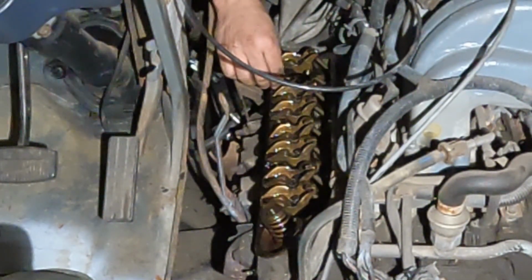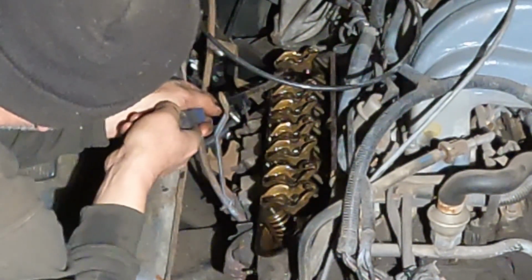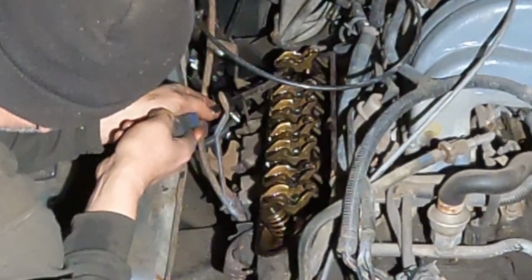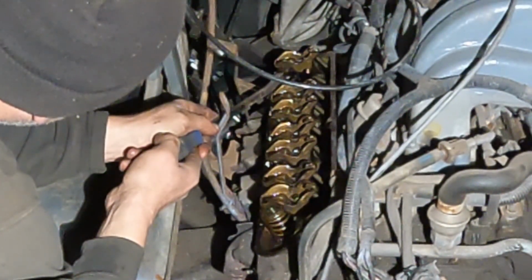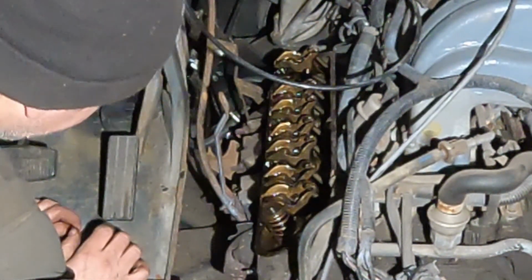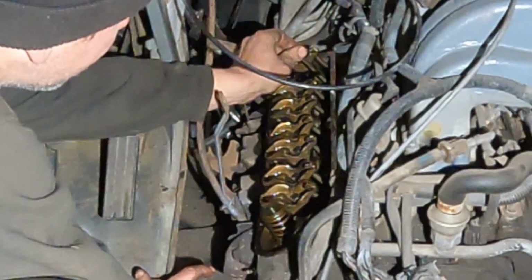So the next question is, why did that bend? Is the valve stuck? It definitely could be. See if I can push the valve down. Oh! The valve's working. Valve's definitely working. Doesn't take much to run it. It's possible when I started this engine, because it sat so long, that intake valve might have been stuck and it bent the push rod because they couldn't compress it.